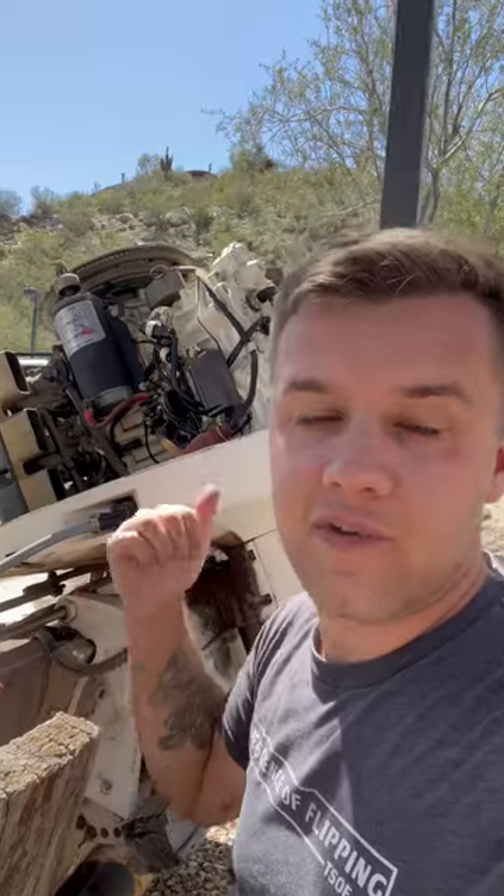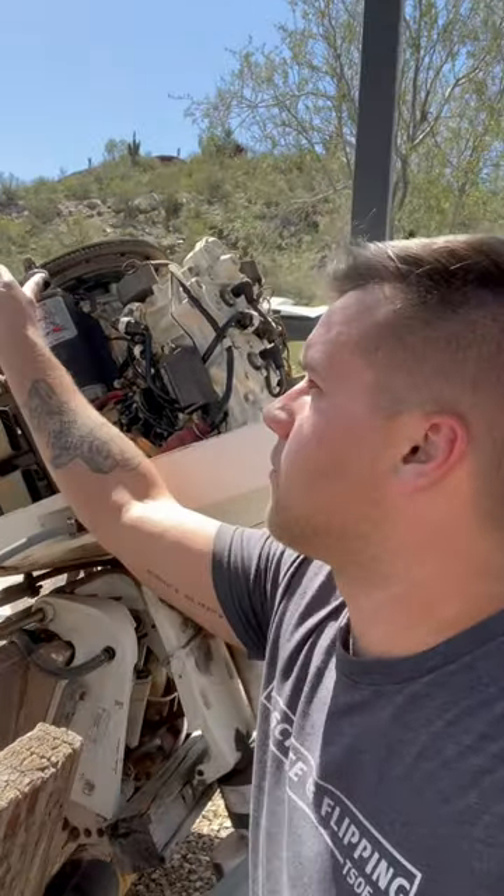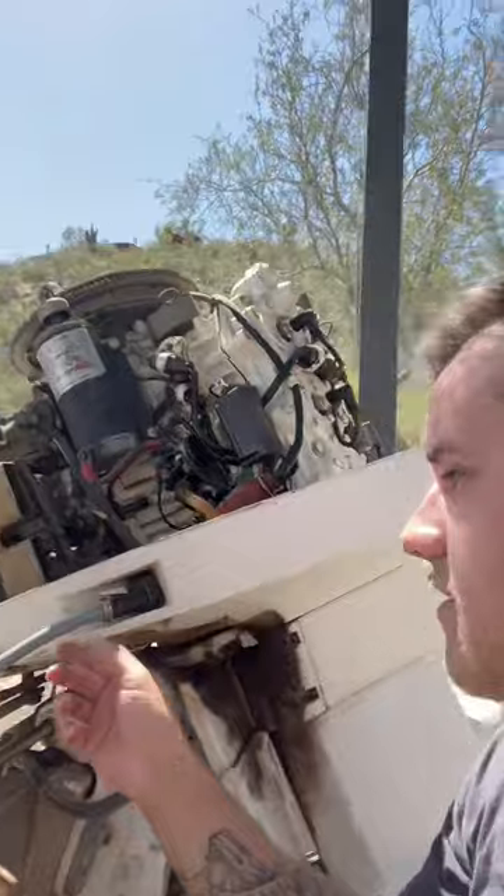So that's actually a good sign, because before when I tried to turn it over, the solenoid wasn't actually engaging to the flywheel on the starter. But it's not going to start because this fuel line connector is not the right one. So I'm going to pick up the right one — stay tuned for part three.